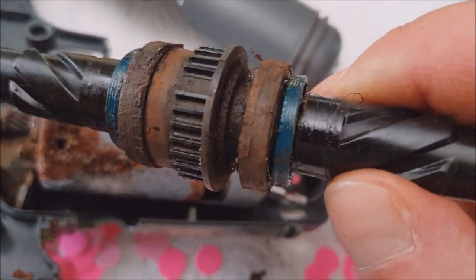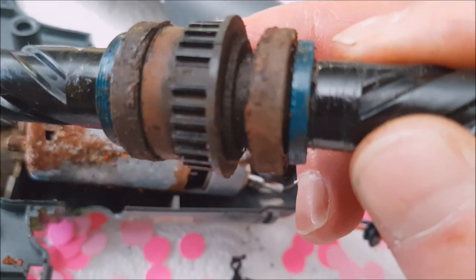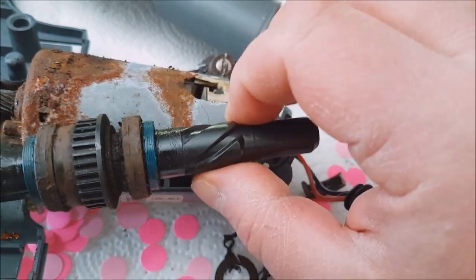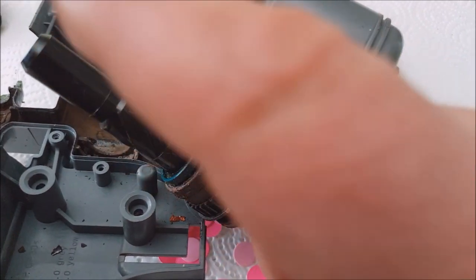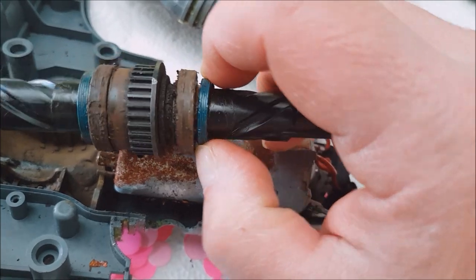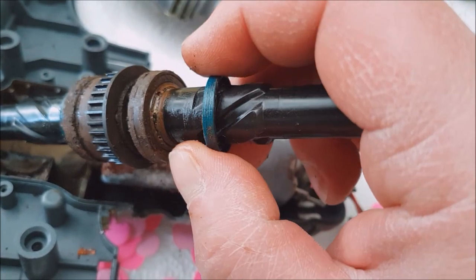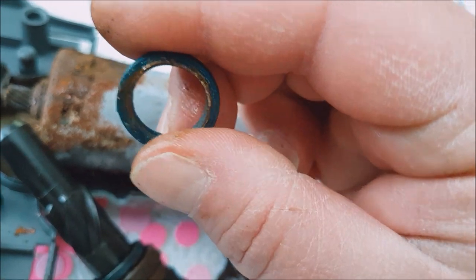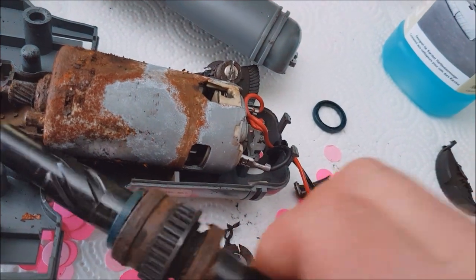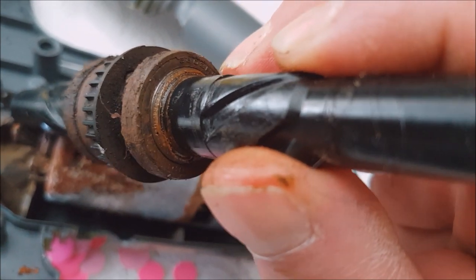Let's take a look at the roller bearings. You can see they are corroded, and quite badly indeed. On this side we have the brush, and just a few millimeters — maybe 10mm — in, we have a bearing which is not even protected by an o-ring or sealing ring, just some sort of plastic bushing which by no means can constitute a reliable humidity-repellent protection.